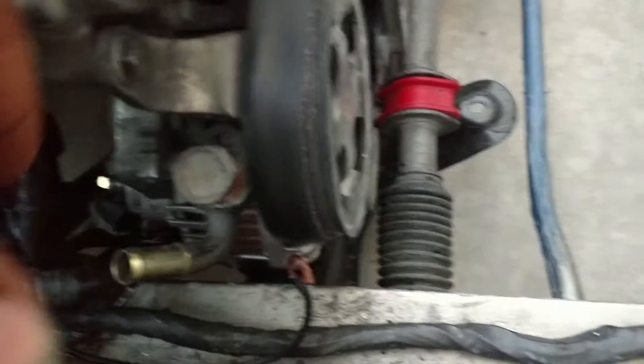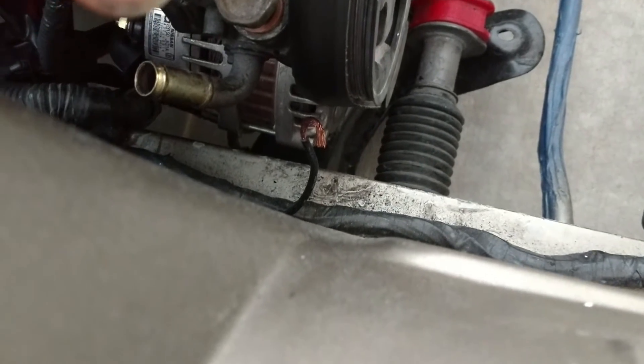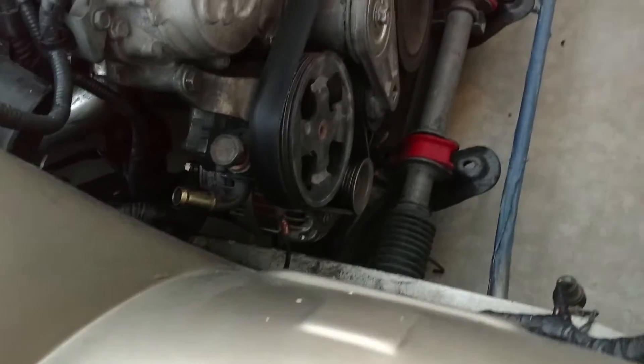What I'm going to do is take the alternator off, take it to the alternator shop, have them press another pulley on and try to pull it out about an eighth of an inch. That will solve my belt issue. I'll get a spare power steering pump, cut it all open, and just make a pulley out of it so it looks a little better.